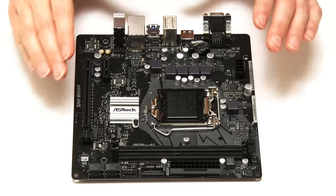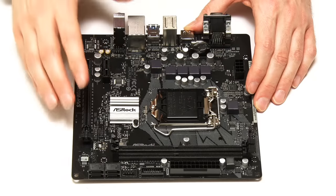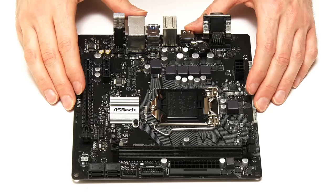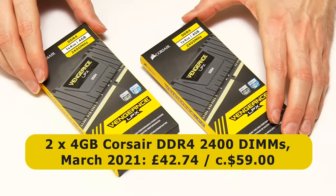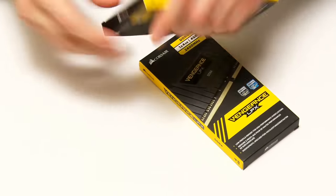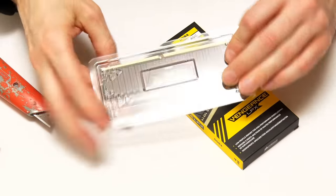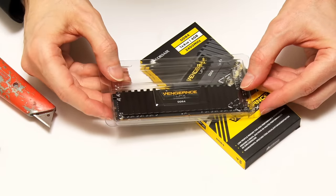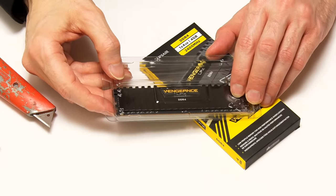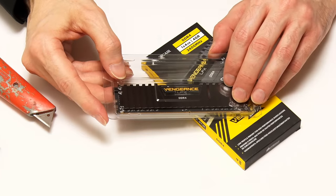As I was talking about motherboard sizes earlier, it's worth noting this is a micro ATX form factor board, but a rather small one at just 197 by 188 millimeters — a lot less across than the permissible 244 millimeters for a micro ATX board. Finally, let's take a look at our memory, where I've got two 4GB Corsair DDR4 2400 DIMMs, which cost me a total of £42.74 or around $59. I found these difficult to get hold of. Some of you are thinking that 2400 megahertz memory is not the fastest available — it isn't. But 2666 megahertz is the fastest supported speed on our motherboard using a Celeron, Pentium, i3 or i5 processor, and 2400 megahertz is still a very respectable and significant upgrade for our PC.